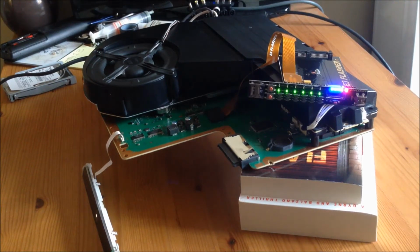Now, when the Nor chips are soldered onto the motherboard in the factory, when Sony make the boards, some of the Nor chips get soldered on slightly crooked, off centre, so it's hard for the clip to actually sit onto the top of the Nor chip properly. So that's why I always just clamp them down, because it causes less problems.